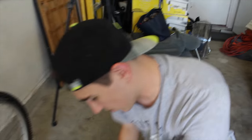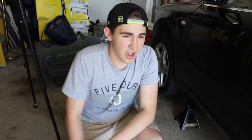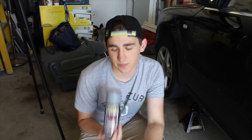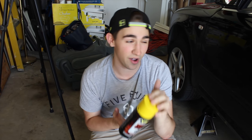We're gonna try to paint my calipers. I was doing some exploring, looking into caliper caps and different brake kits and things like that, but it's just so damn expensive. So what we're actually gonna do today — we've got some aggressive degreaser, we're gonna make sure we clean off all the calipers. We're actually gonna fully remove the calipers while we're at it, get everything clean, take the calipers completely off the car, and give it a nice coat of primer.